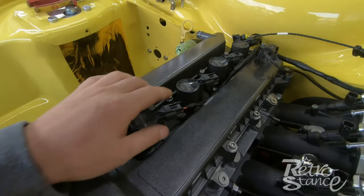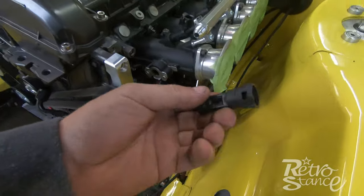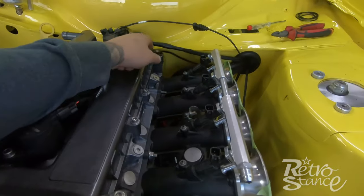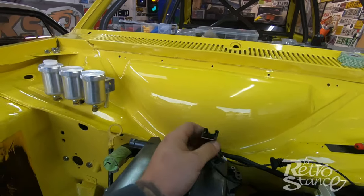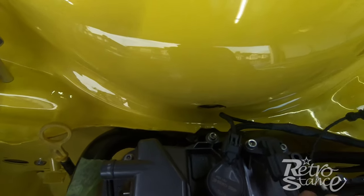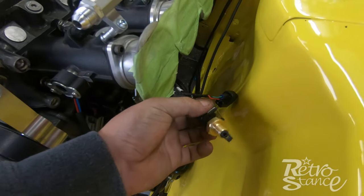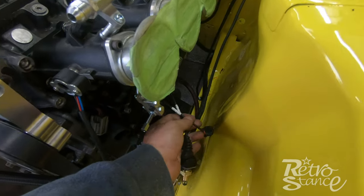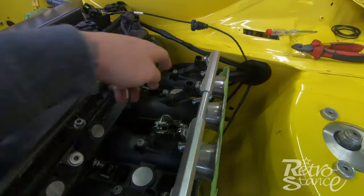I was messing around with the wiring — the injector plugs are all done. I'm waiting for a different plug for the TPS and a different plug for the crank sensor. The cam sensor's done. Not sure what I'm going to do with the water temp because the sensor is all the way down there and I can't get a sensor on it, so I might put an inline one in. Air temp sensor still needs a little mount on the throttle bodies. I'm also going to extend all the injector wiring to run underneath rather than over the top.